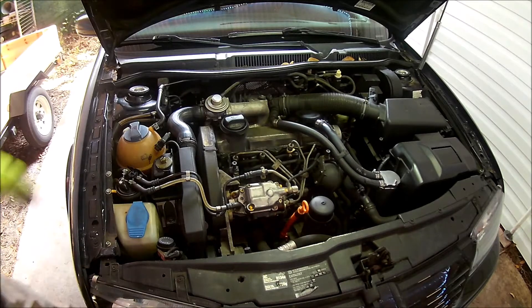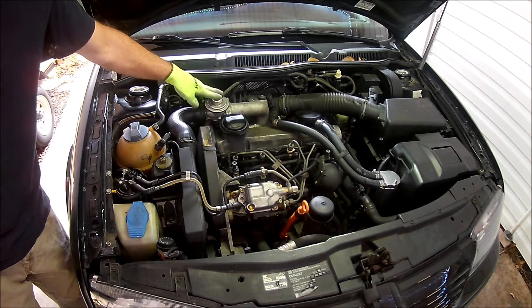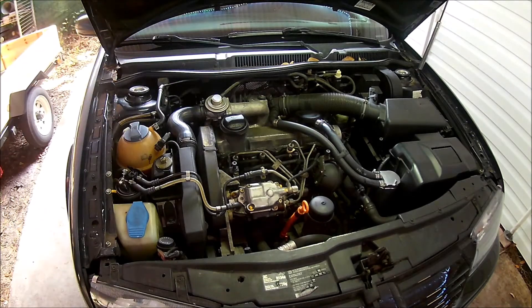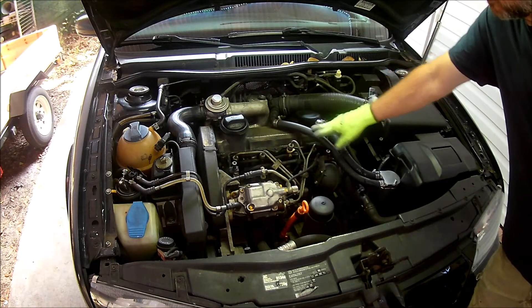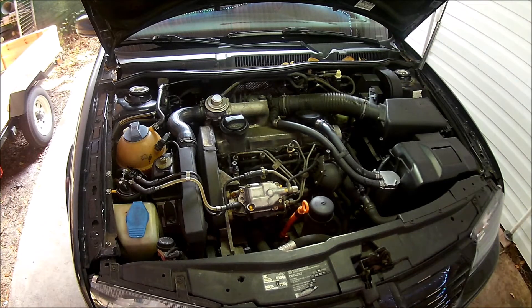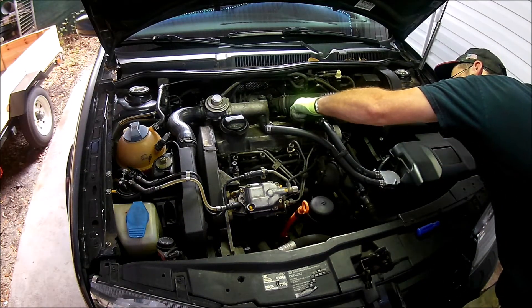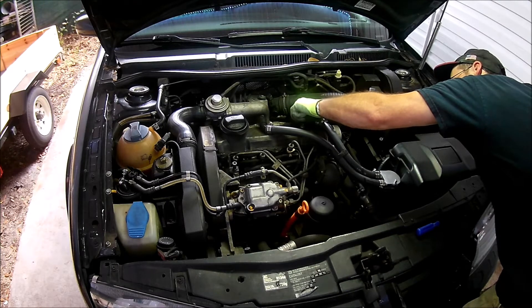Anyway, let's get that gasket installed. Of course the valve cover needs to come off. I'm gonna try to do that without removing the timing cover or the EGR valve, but I will need to remove the PCV system and the intake hose. I'll start with the PCV system. The PCV oil separator is made of plastic and gets brittle with age, so I was careful not to break it.